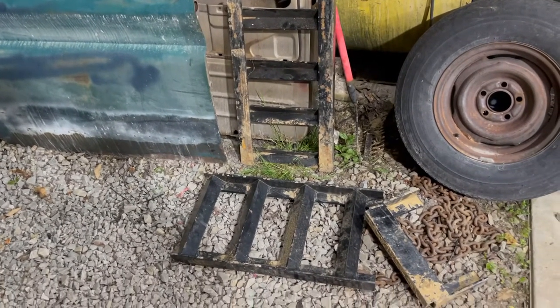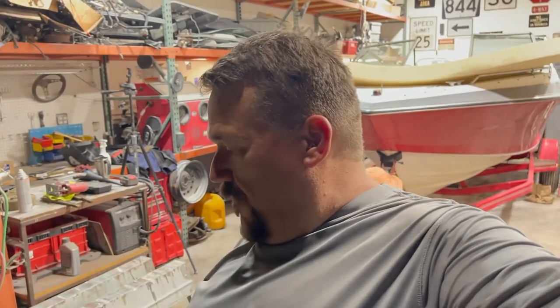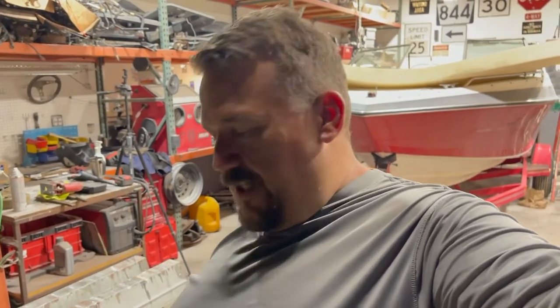The reason I want to do that is because those ramps, as you saw on that video, tuck really neatly up underneath of that corn pro, and I want to retain that ability to tuck them up under there. So I don't want to attach those extensions permanently. I want them just pinned on there to where I can slip the pins out, take the extensions off, throw those up in the bed, or maybe I'll make pockets for them in the front of the trailer. That way they just slide on the trailer and you always have them with you if you need them.